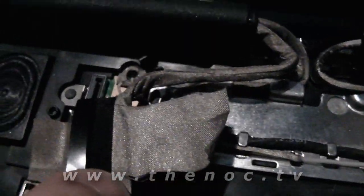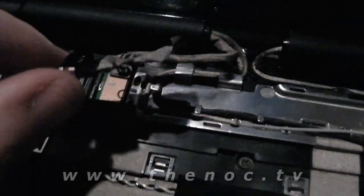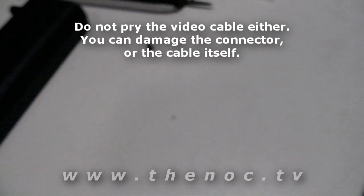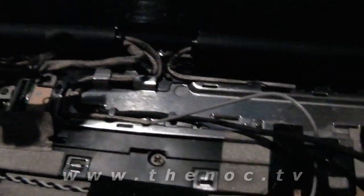It amazes me sometimes. But go ahead, and when you're pulling up on the video connector, be sure you pull straight up. Don't try and get at an angle, because these things are very, very thin these days. Those can break. Given that we are replacing it still, you don't want to actually damage the possible receiver there. And there's usually a grounding screw attached. Conveniently, already removed that. So now we can just do the fun part of pulling up the wiring here and trying to do the oh-so-careful job so we don't screw up these guide pins or possibly the wires if for some reason we have to put the screen back in. So